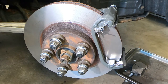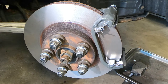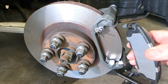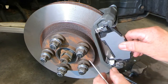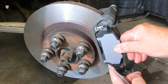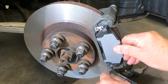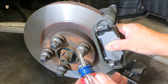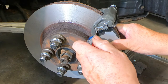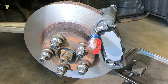I'm ready to install the pad on the outside first. Both pads are identical, so it doesn't matter which one you grab. What I'm going to do is put the indicator loop around the tang, install that, then press down on that little tab I mentioned. I'll install the other tang and press the pad right up against the rotor. Now that this one's installed, I'm going to take a stubby screwdriver and wedge it right in there to hold that in place.